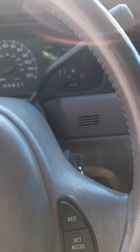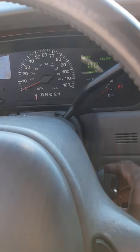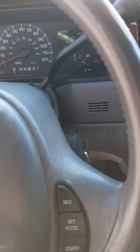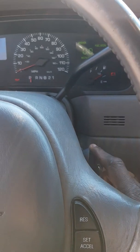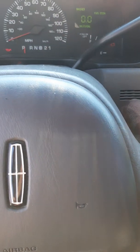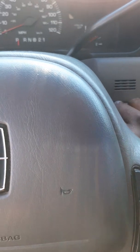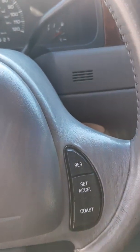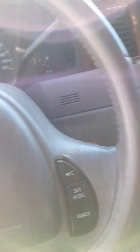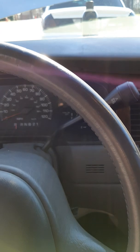So I've got to find out. Like I said, I think it's the fuel pump going bad on this thing. I just turned it over — just sprayed some starter fluid in it — and you can see it cranked over and then shut itself back off. So it doesn't seem to be getting fuel. It'll turn over but it won't stay running. I can spray starter fluid in here as you can see.